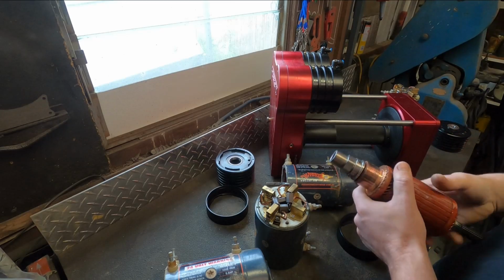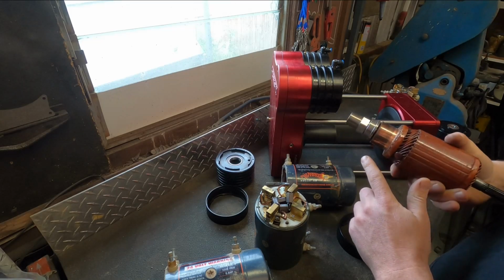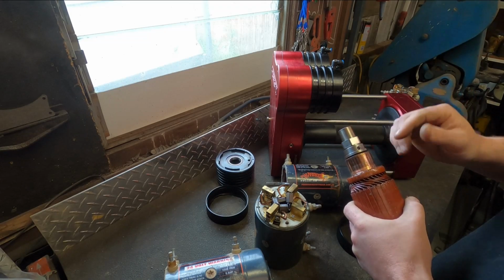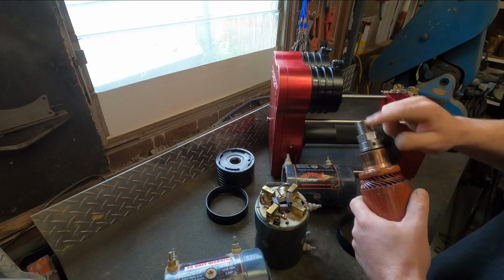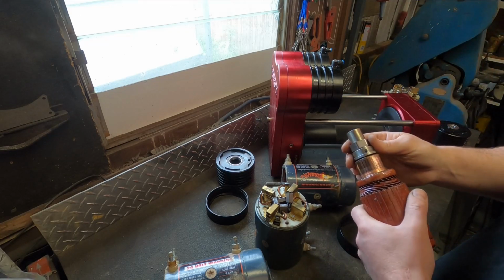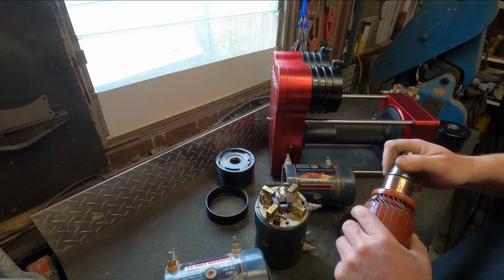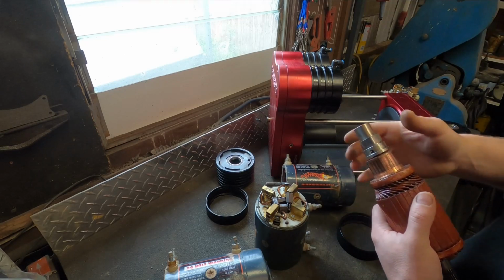Now lots of these twin motor adapters have been sort of played with and developed over the years. This one doesn't require a keyway or anything to be cut in the armature. You drill a little dimple hole about 5.5mm off the step. You freeze the armature in the freezer. You put the adapter collar or the adapter unit into the oven at 250 degrees, whatever you can get it up to. Leave that all in there. Basically what happens after that is you just gently tap this on with a soft blow hammer or an aluminium hammer. Locate the grub screw, and that shrink fits on there.